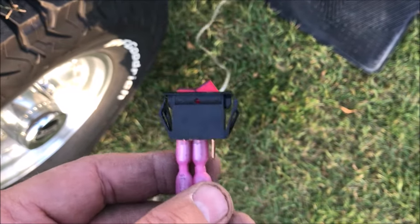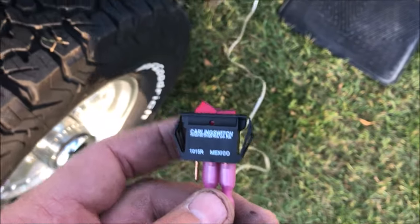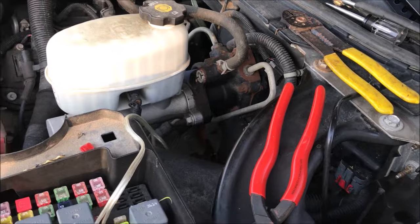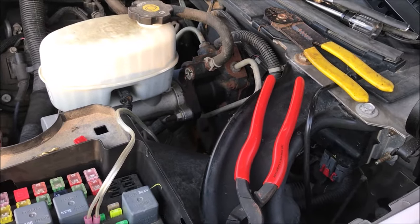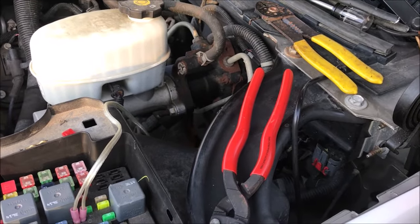This is just a little three-position switch and we're only using one side of it. So when he goes to start the car right now, nothing happens — the car doesn't turn over, doesn't do anything. If a thief comes with a tow truck, he can still do his job, but if it's a smash and grab, he's probably going to be frustrated and bail.